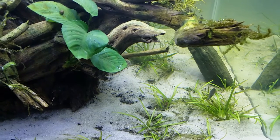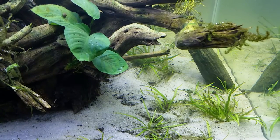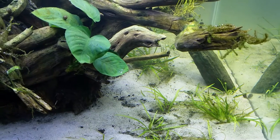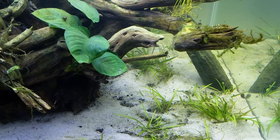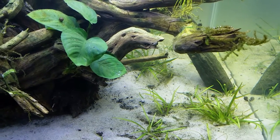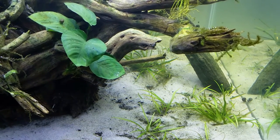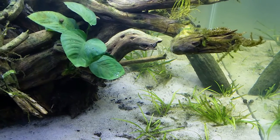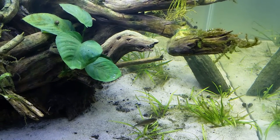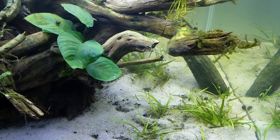What I actually did to eliminate the blue light was very simple. I took the lighting unit off on the right side, dried it thoroughly, and placed little one to two square centimeter sections of electrical tape over the blue LEDs. The tape is applied to the glass on the LED panel, not to the LED panel itself, which is securely isolated under the glass. I sealed it carefully to make sure there are no bubbles where water could leak in between the glass and the tape. With about 10 to 20 pieces of tape, I cut all of that horribly annoying blue. Pretty cool, huh?